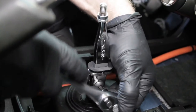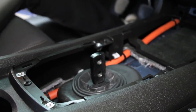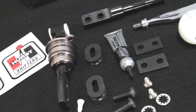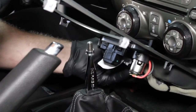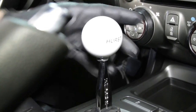Hurst provides their signature chrome stick, which is simply mounted with two mounting washers and bolts. The kit also allows you to use your stock stick if you prefer, and rubber isolators are provided for optional vibration and noise reduction. From there it was a simple reassembly of the rubber boot trim assembly, wiring harnesses, and leather boot before mounting the signature Hurst shift knob to complete that classic Hurst look.